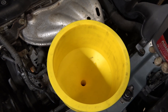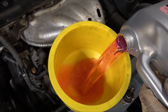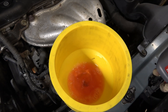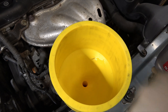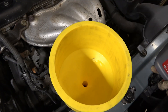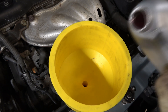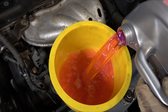Let me show you this — it's another thing I've learned by using this. Watch as I pour water or coolant in here and then stop. See how it's bubbling right there? It's like the easiest way to check to see if there is a leak in the system you just fixed. If you start pouring coolant in and it kind of swirls around like water going down a drain, that means air is getting in from somewhere and chances are the coolant you're pouring in is dripping out somewhere. So that is like an early warning — it has helped me many times over the years. If I see those little chug-a-lugs then I know this thing is working as it should.